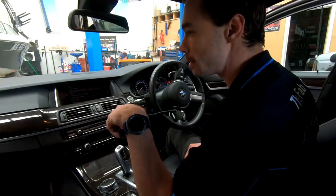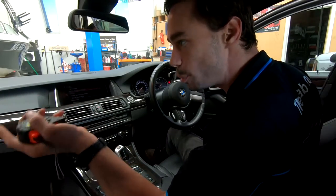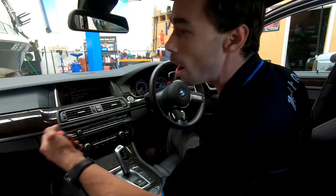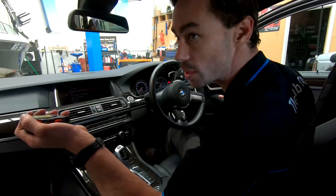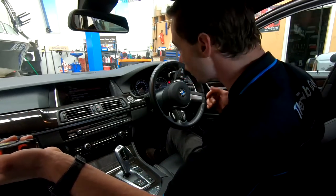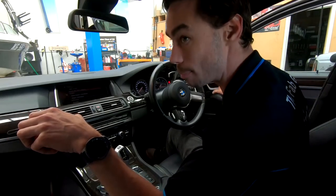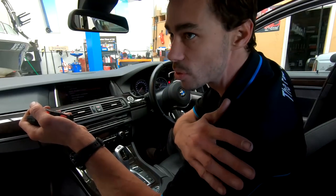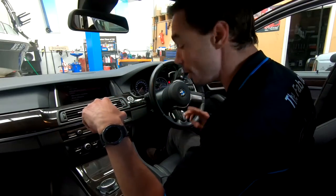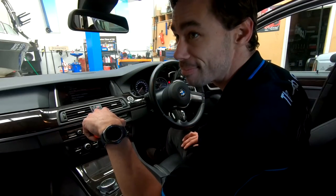But with this car, because we're running passive on the fronts, you lack a little bit of tunability between the tweeters and the mids. Normally if we were doing a full active system, then you have a lot more adjustability, because you can adjust the tweeters and the mids separately and time align them separately. As it is now, they're linked together on a crossover and I have to time align them as a pair. Which is fine, that's how this amplifier is designed to work. Then you can add that little bit in the center just to give it a tiny bit of extra staging. But the funny thing is, I can turn that center channel off and it still sounds like it's coming from there. It's pretty high-tech stuff, isn't it?